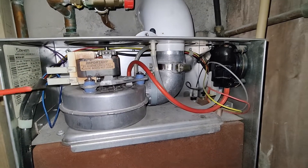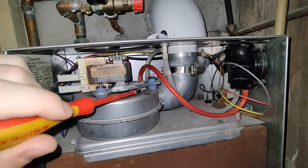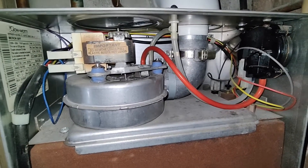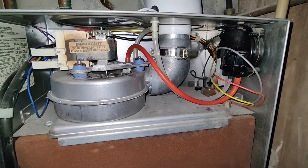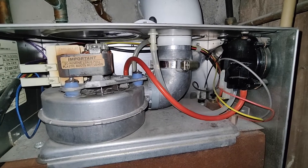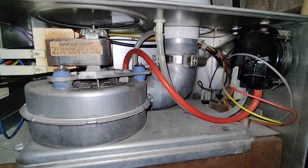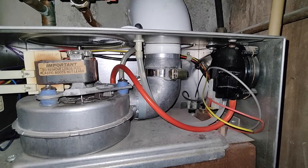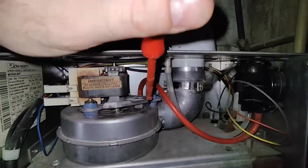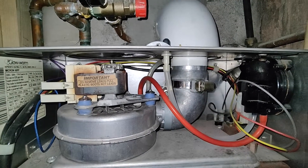This is the fan and that's what's actually causing the wearing noise. This one is okay now because I gave it a little drop of WD-40. The way you want to do that is to just spray it just up there where the top bearing is and just under there where the bottom bearing is. Then you can test it again — if it fires up and starts to move easier or make less noise, then you know the bearing itself is the problem. It feels okay now but that won't last obviously.